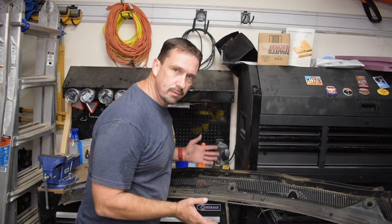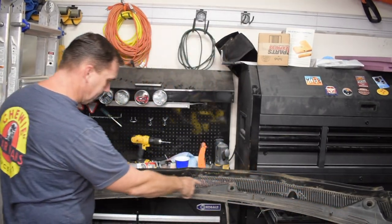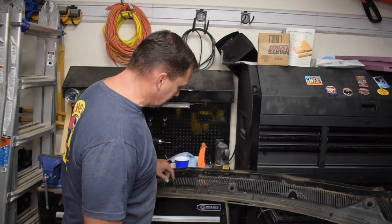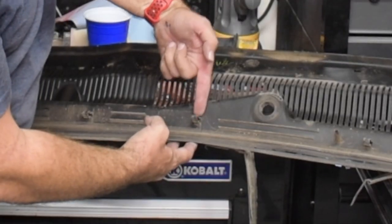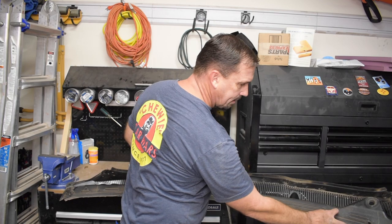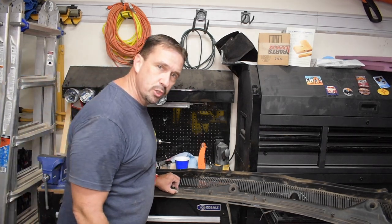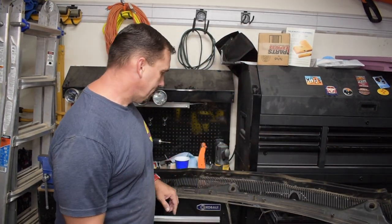Just a post-removal analysis of the part so we know what we're doing when we put the new one on. The clips I was talking about are actually a couple of clips along the back of the cowl that clip into the piece of steel running along the base of the windshield. They're these plastic rubbery clips — if you push on them one by one just right as you pull up, they pull out of the slot. There are also posts that hold it in place, plus six clips at the back — the same number of push clips we removed at the front. Overall, not that hard.